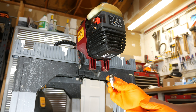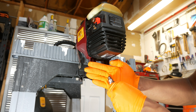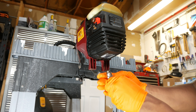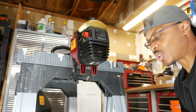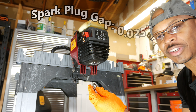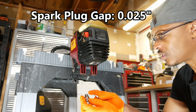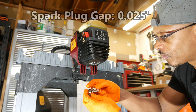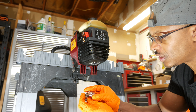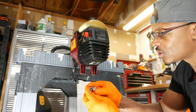There is our spark plug — it looks fairly flat. I think this is a newer spark plug; I think I've tried to get this started several times, so the spark plug is most likely fine. I've got a spark plug gap tool here and I'm going to check the space between the electrode and the tip. It should be 0.025 inches. It's already pretty tight — about 0.025 inches. So that's perfect.